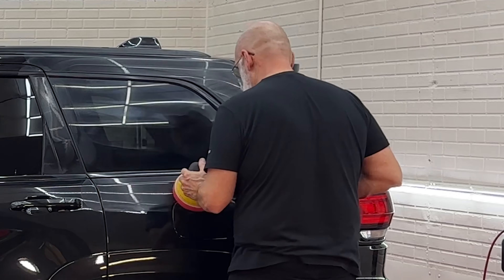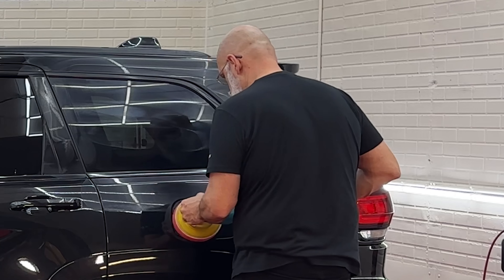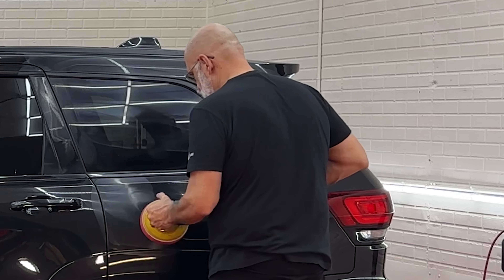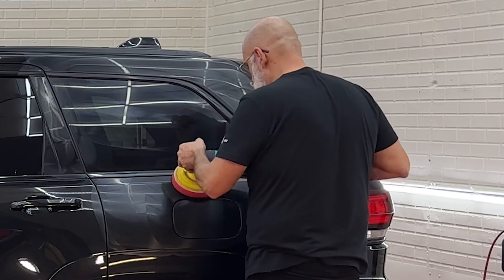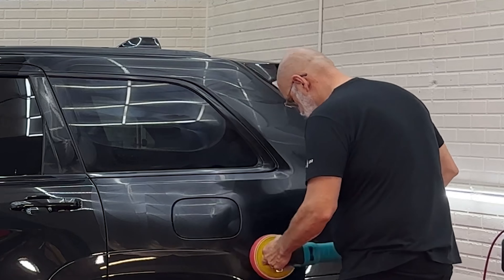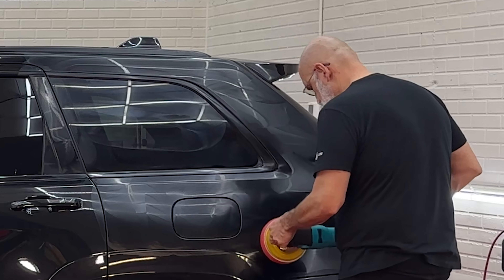As I've been polishing, I'm going to tell you the reason why we're using this rotary jeweling pad. It is a fantastic finishing pad to really gloss up your paint. If you're going after defect removal, this is not the pad for you — this is your final step. You could use our wool cutting pad on the dual action polisher for heavy cutting. We love the wool pad with a 21-millimeter throw dual action polisher — that's our 6.5-inch pad, basically a defect monster.